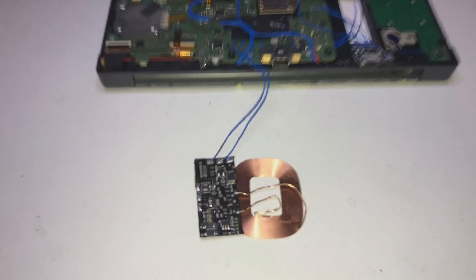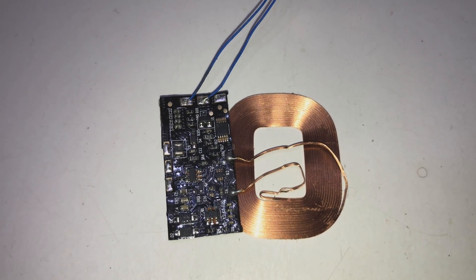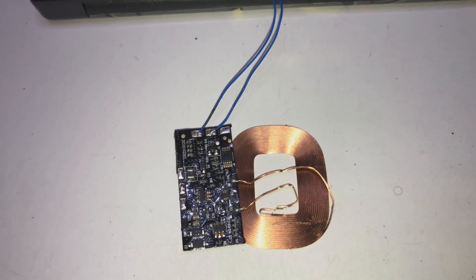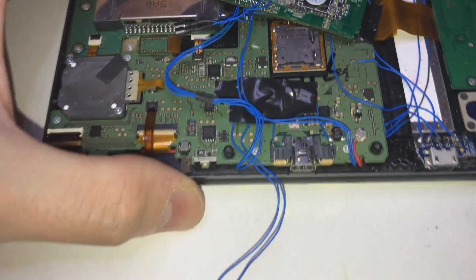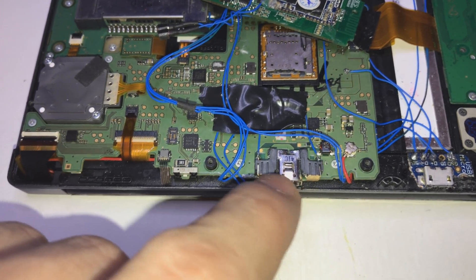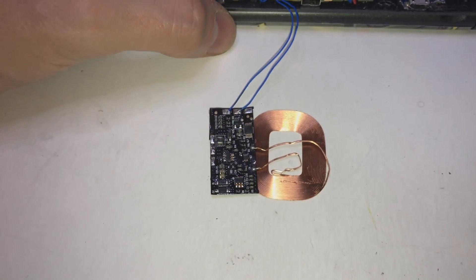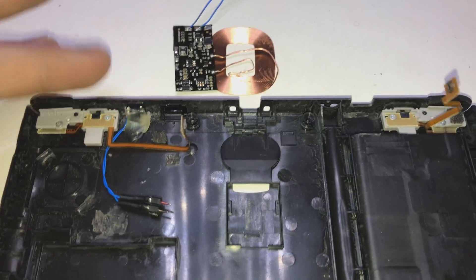You can see the coil here and some kind of motherboard there. Once you disassemble that, you strip the wires and keep the coil. What I did was fold it slightly over itself and solder two wires to it - that's pretty much all. All you need to do is make it as compact as possible, put two wires on it and route them to your charger. So you can see I have one wire there and one wire there. Once you have that, you need to fit it inside your housing - it goes right here, and you're golden.